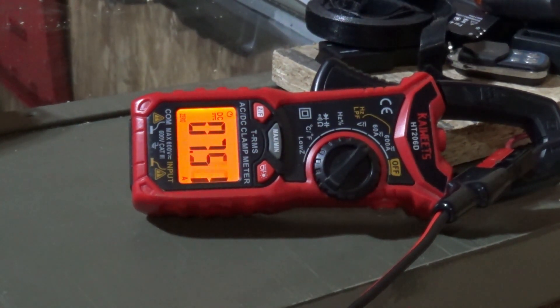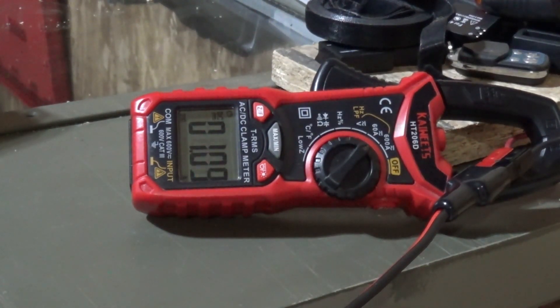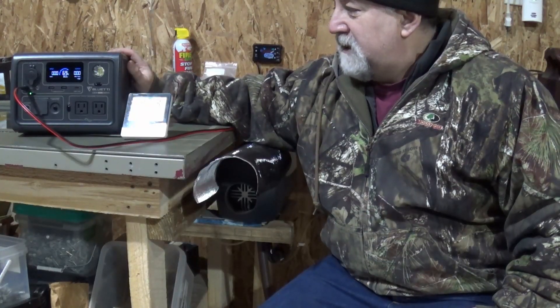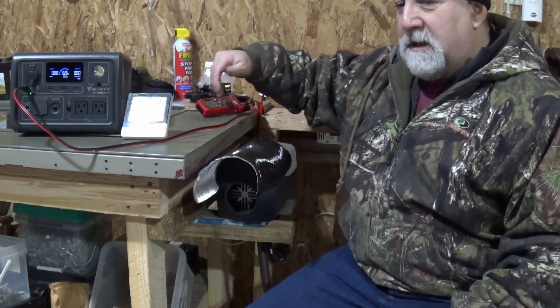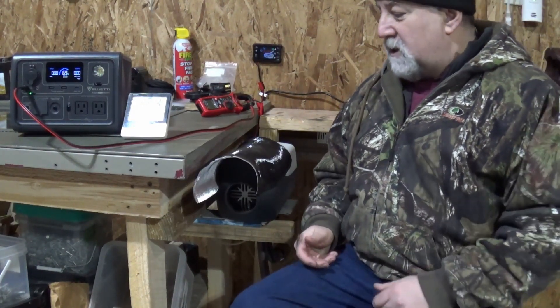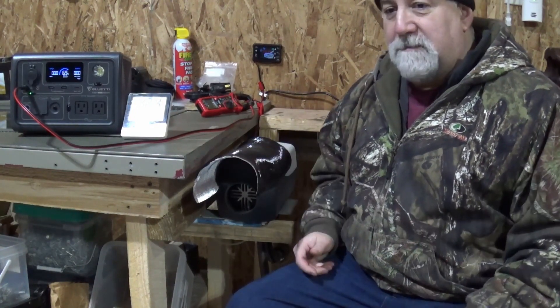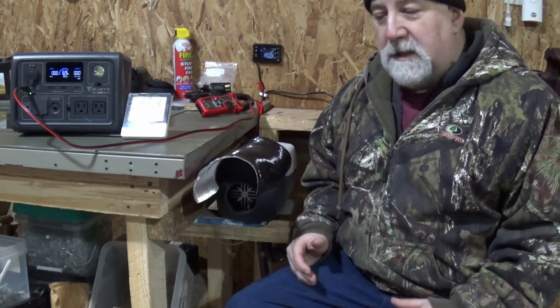This procedure takes a couple of minutes. We're finishing at just about 70%, a little bit under. The power consumption is definitely going up — that's definitely got to be the glow plug kicking on. I'll put links to the cord I use in the description below, and a link to the meter I'm using in case you're interested in getting your own measurements. In my opinion, that's the way to learn how these things work: watch the power consumption, keep a close eye on it, watch your fuel consumption, and figure out what works best for you in your particular installation.